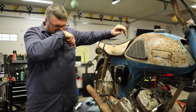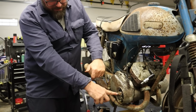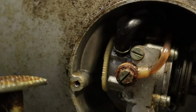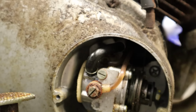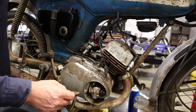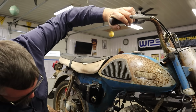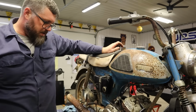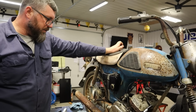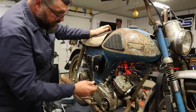We do need to prime. Do want to prime the oil lines. So when we kick it, watch this little gear. Yeah, see that moving? And then as you twist the throttle, there's a split up in here. Oh, throttle still doesn't want to move. That throttle's that crusty. Moves. Yeah, that was sprinkling stuff while you were turning it. Was it? Well, yeah. I guess we got to get that taken apart too. This stuff here is going to have to come apart. We're going to have to get these cables lubed up.